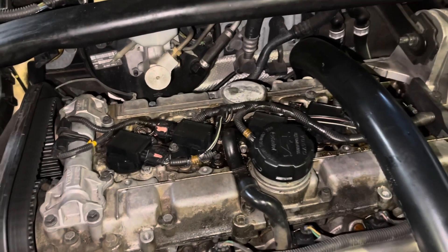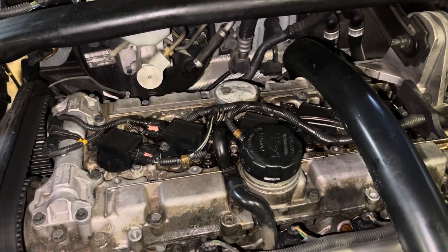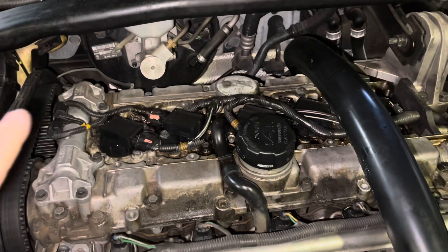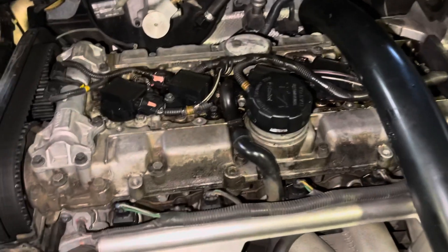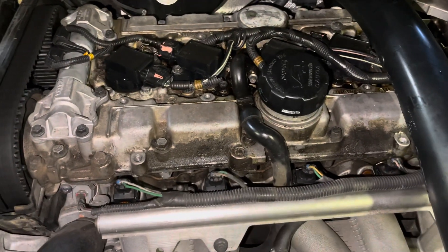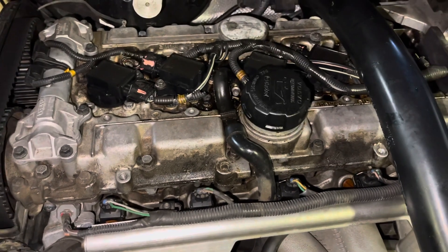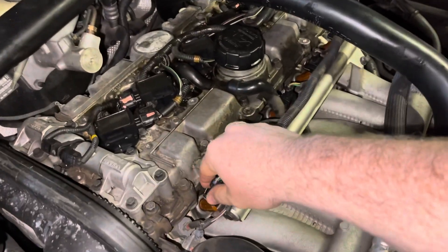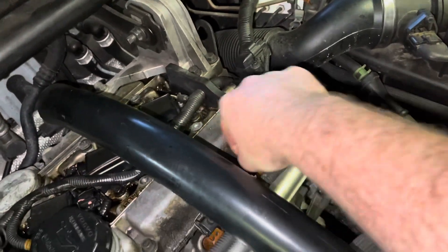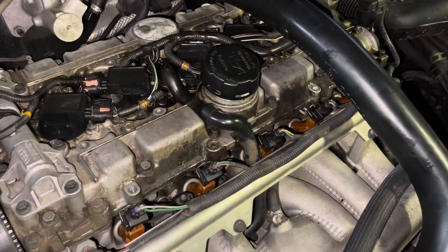The best thing to do is go through all the cylinders one by one and compression check each of them. One thing is you don't actually want the motor to start when you're doing this — you just want it to crank over — so you can either remove the spark or the fuel. The fuel is probably better, just so it's not injecting fuel into a cylinder that's not firing. So I've pulled off the trim to my injectors and I'm going to unplug each of these plugs. One, two, three, four, and five — so now all five injectors are unplugged and fuel can't get into the cylinders whilst we're doing a compression check.